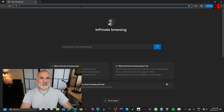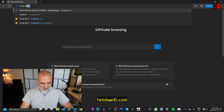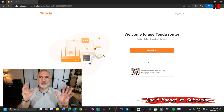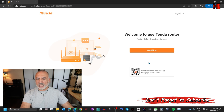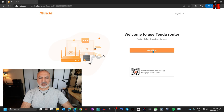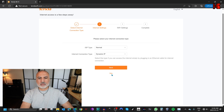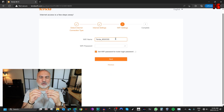Open your web browser and put this URL: tendawifi.com. It will take you to the admin page of the router. Because we reset the router, we have the initial setup page. Click on start now, then click on ignore and continue because it didn't detect an internet connection — which is very normal — and here also click on skip. Here you need to put a Wi-Fi name, which is an SSID for the router, and this will act as the extended network when we configure the router.